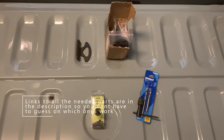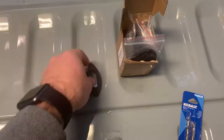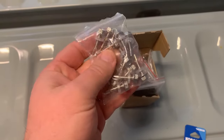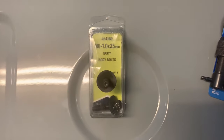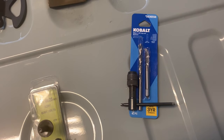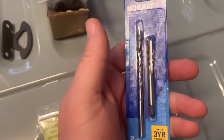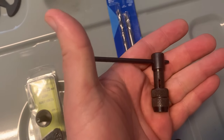Going over the parts — all linked in the description. First, the tie downs themselves: those Amazon tie downs we talked about earlier. They come with some self-tapping screws, but those are too small for Ford's holes, so those won't work. We had to buy our own M6 size bolts — I got these from AutoZone, with a couple variations to see which ones we'll use. We also need to tap those holes since Ford didn't ship the truck with them threaded, so we have a 6mm tap and a tap wrench.